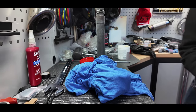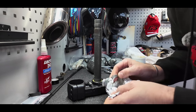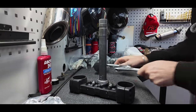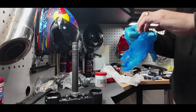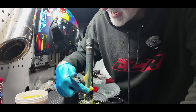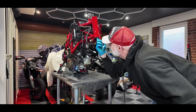That's cold — keep it covered, keep it cold! Quick, let's go get the hot ones. It's already greased. Hot hot hot — bearing seated. I'm going to slap a load of grease on that, fit the yokes, and also grease the shaft. I'm putting a load inside the frame as well.